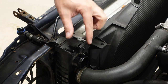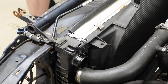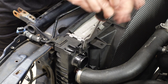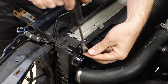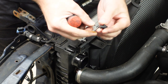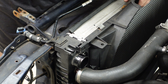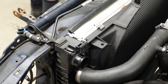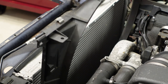Next is to get the fan shroud out. There are two push pins, and you use a small trim tool to work each pin out. Just pop the pin out — use finesse. Try not to pull the pin all the way out; keep it partially in so it releases pressure and you can keep it together, otherwise you'll lose it. Do the same on the other side. The fan shroud just clips in and pulls straight out.